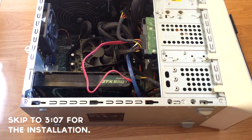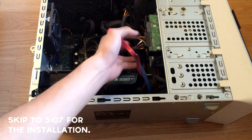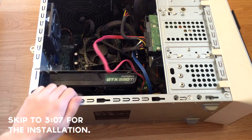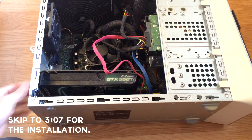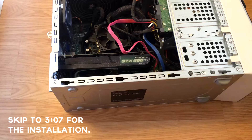But what you're going to want to do is take your current GPU out — first by unplugging it. There might be one or two cables that you have to unplug. In this case I only have one from the power supply. What you do now is unscrew the bolt, the screw here to the side. It should also be noted that not every chassis has an option to unscrew like this — some probably have alternate ways to secure the GPU, but in my case it's just a screw.